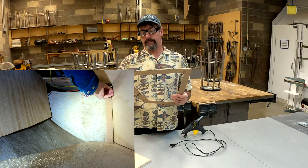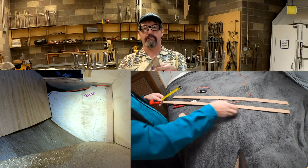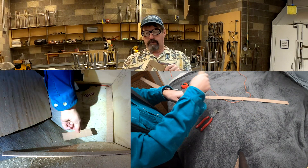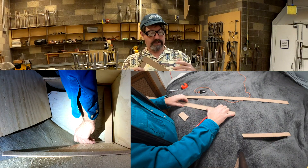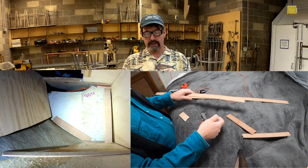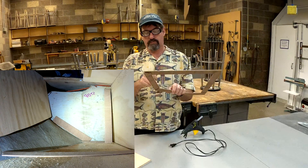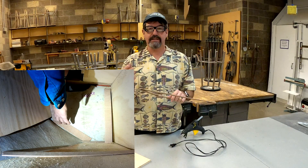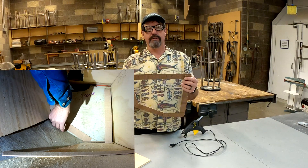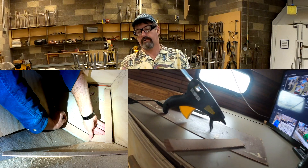You simply take and get approximate lengths, but a little bit shorter. A little bit shorter is always the key, and we'll fill in the corners later. I measure with a tape measure sometimes; if it's short I'll just use my hand — it's just approximate. You can break the door skin, cut it with a set of dykes, or score it with a razor knife. It breaks really easy. This is fast. On longer ones, if it's 13 inches I'm going to cut it at 12 or 12 and a quarter.